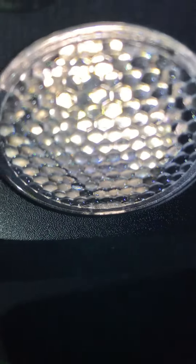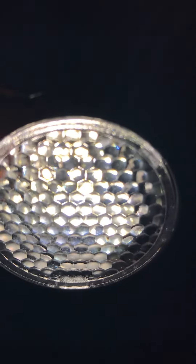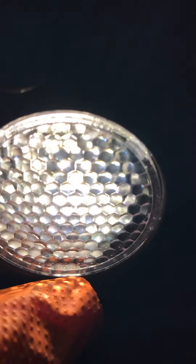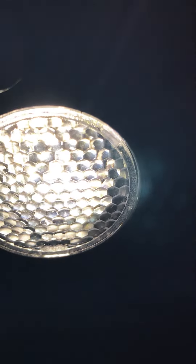All you have to do is take a small screwdriver. There are three points on here — two of them pull down and then the back one's a hinge. So you take a small screwdriver and pry it in here and right over here on this side. You can see the coloration marks here and here, and then it hinges at the back right here. So it'll fold down almost like a trap door, and then you can reach in with a small pair of needle nose and pull the bulb out.